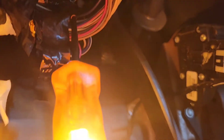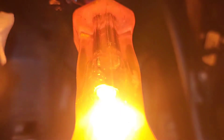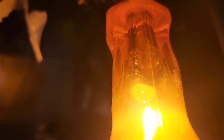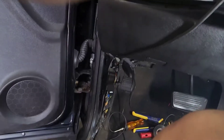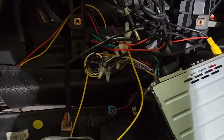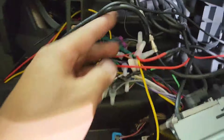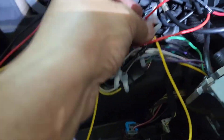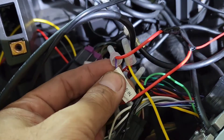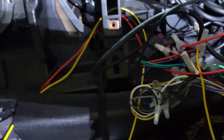After I ran it, I tested it to make sure that when I put it in reverse it turns on red like that. That confirmed it's the right wire. Once you run that reverse wire, you're going to connect it to the reverse input — most radios will label it as reverse or backup camera.